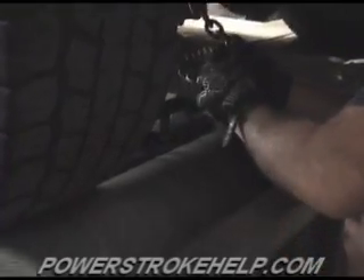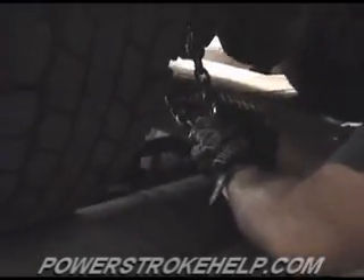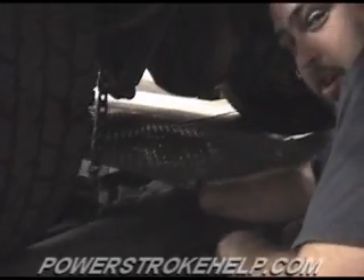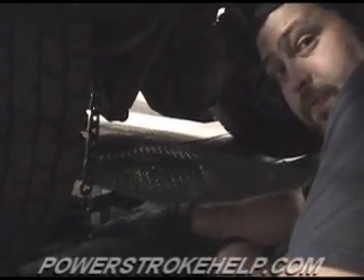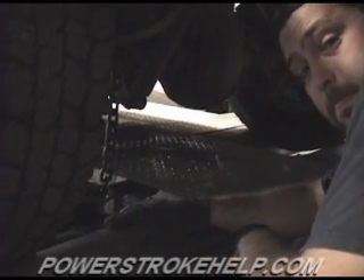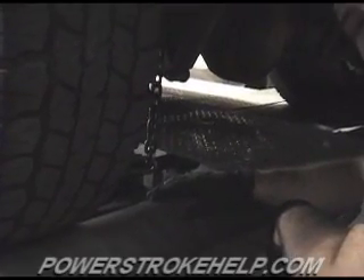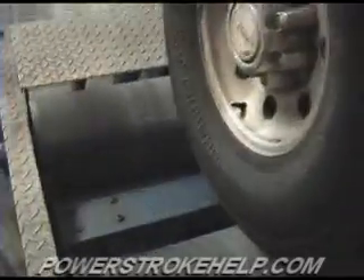It's Eddy Current. Okay, how does Eddy Current work in a nutshell? Well, it uses electricity to put a load on the rollers, and it simulates the weight of the vehicle. And then from there, depending on the forces that are generated by the tires onto the rollers, it extrapolates the numbers into the computer — it gives you the numbers you make. I just know that the thing will churn out the numbers, which is what's important to me.